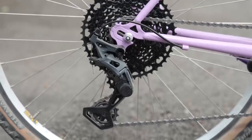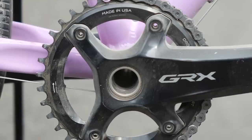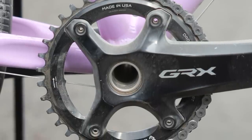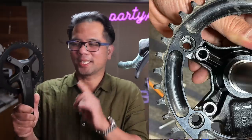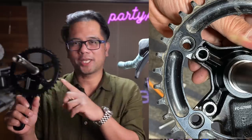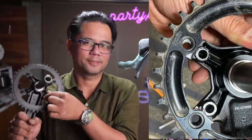Now, the BCD looks identical to GRX, so couldn't you take an aftermarket chainring — say from Wolf Tooth — and put it on the Sword crankset? I tried that: I removed the Wolf Tooth chainring from my GRX crank and tried to install it onto the Sword crank. While the BCD is indeed identical, the shape of the tabs on the chainring are not. When I tried to put the Wolf Tooth chainring on, it would lay flat on two of the holes but the tabs would interfere with how the crank arm was actually machined. You either have to file away the tabs so the chainring fits flush, or you have to get a new crankset — both options are not great.